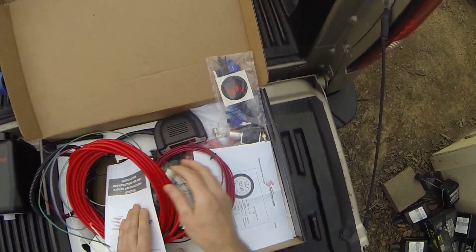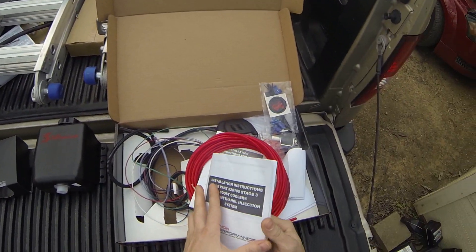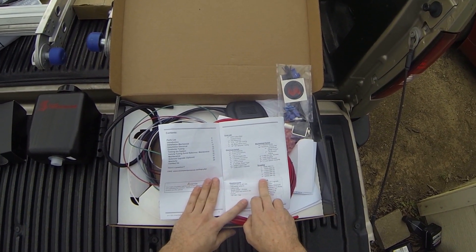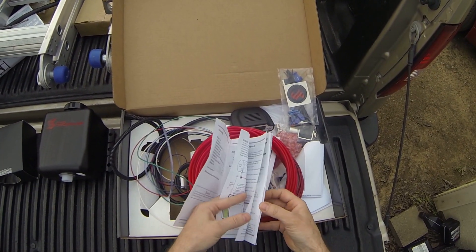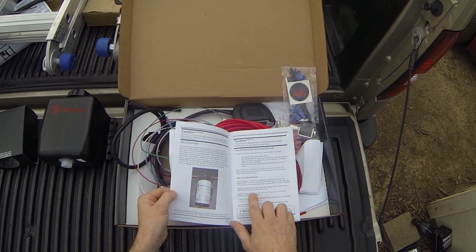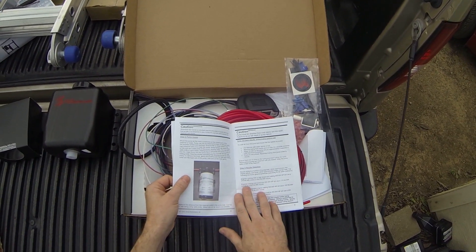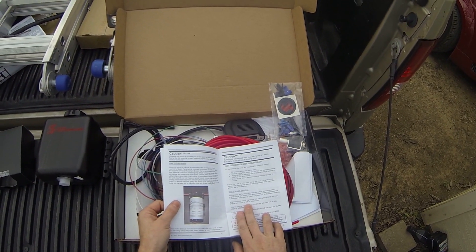You also have your basic instruction manual that comes with the kit. Depending on what horsepower you're using, they add what kind of nozzles you need. It will tell you in the book what horsepower application calls for which nozzle — engines with mild boost get this much, engines running high boost use these particular nozzles. I will probably start with the 375 nozzle, tune out my car, and then put the 625 in there as well.